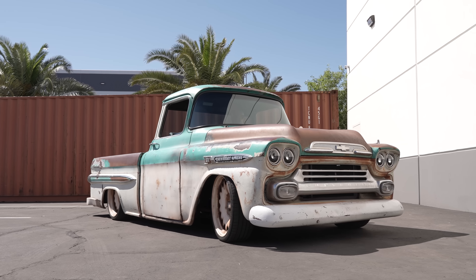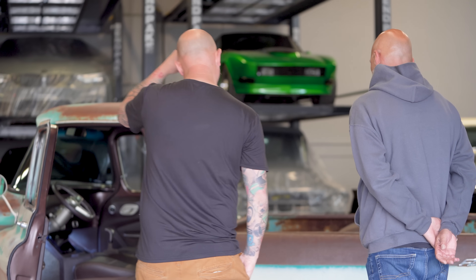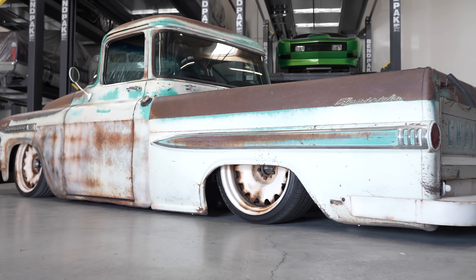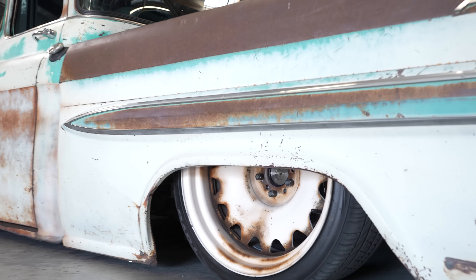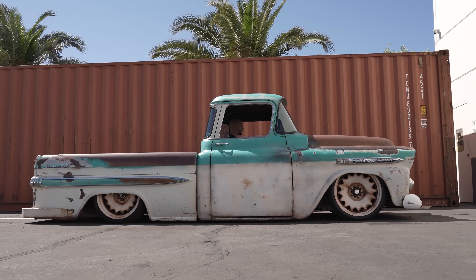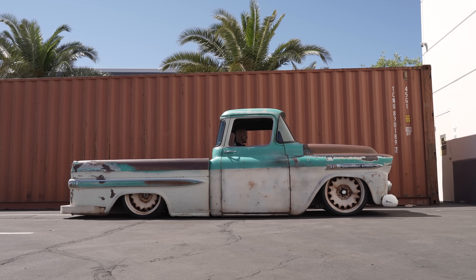The interior did take 45 days — we banged out the interior. It might have been sheet metal fab for three months and then it went together pretty quick. The wheels — they're 20s all the way around. 20 by 12s in the rear and 20 by 9s in the front. 335/30/20 in the rear and 255/40/20 in the front.